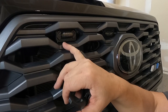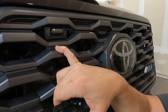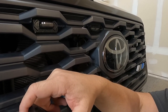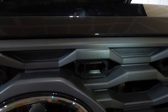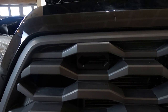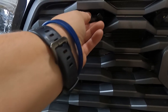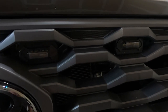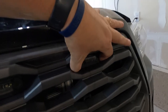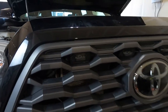What I found was easiest was actually to put the clip in and get it secured first, then just thread the Raptor lights into it. On the pro style or heritage grill, that's all you're doing — really just threading these in. So I'm going to put the brackets in first and then work on putting the lights in after. I've got a flashlight here to help you see since it's black-on-black on that smoked-out grill. Then you just slide these right in. I found it a little bit easier to put my hand in, hold it and secure it in place while putting that in there. Hard to do that and hold the camera, but now those are in place. I went with the smoked out — I just kind of like how it looks with the grill.